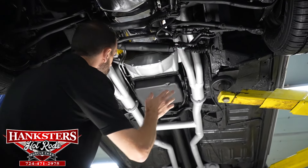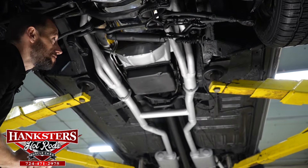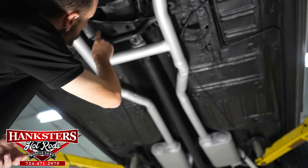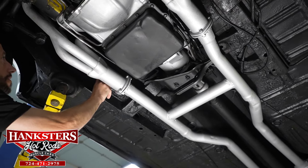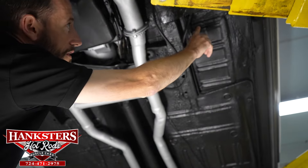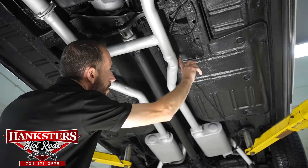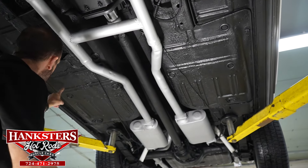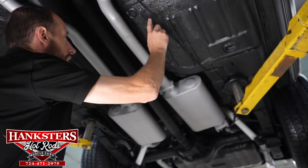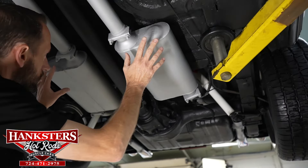We do have dual exhaust on the vehicle. We've got long-tube exhaust headers, we've got a crossover pipe going back into dual Flowmaster mufflers. Our transmission cross member here looks good. Our floors look good up in here - we've got all our embossments. Out here on both sides you've got all your embossments, you can see your lines - that looks good. All your grommets are present on both sides, all your embossed lines are present coming all the way back. We also have our drains here as well, and we've got our e-brake cables running back to the rear wheels. We've got a balanced drive shaft.